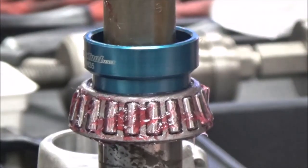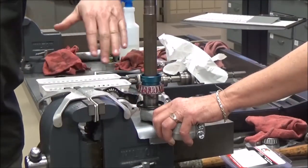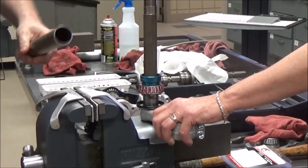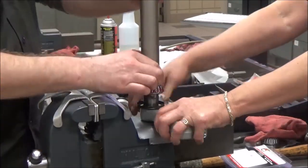We're going to go ahead and get sized up here. I want you to see something else: we put a little duct tape here, and this is important — we're trying to support the bottom so it can't go anywhere. I see a lot of people trying to do it up here, or they'll have it pinched in a vise, and you're taking a risk that it can push through. You want a flat surface underneath.